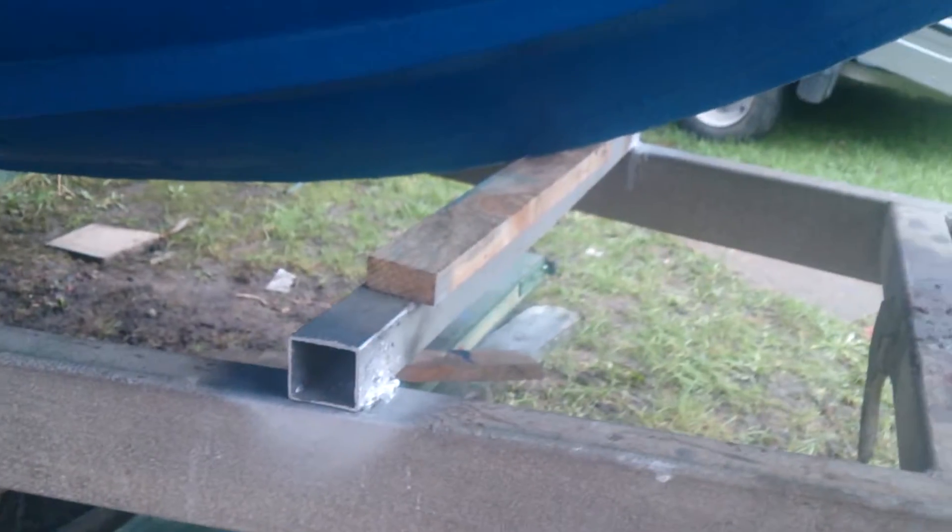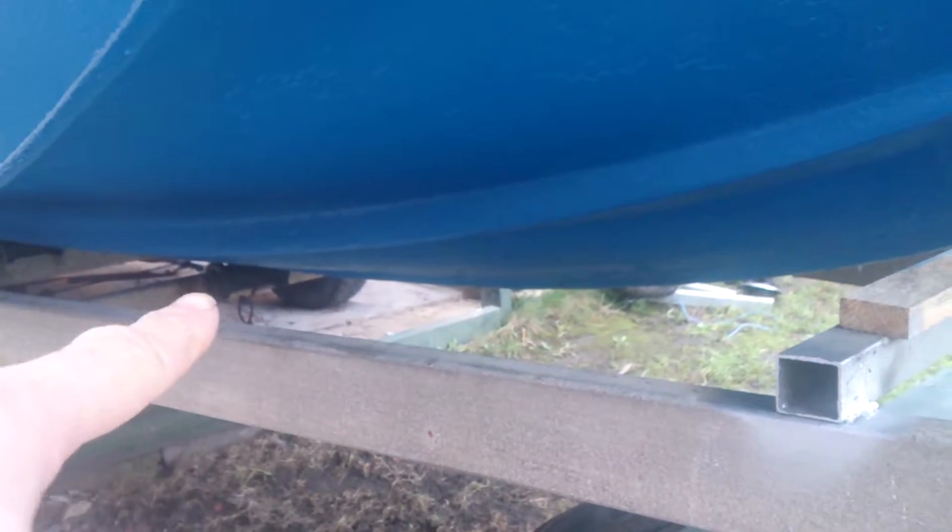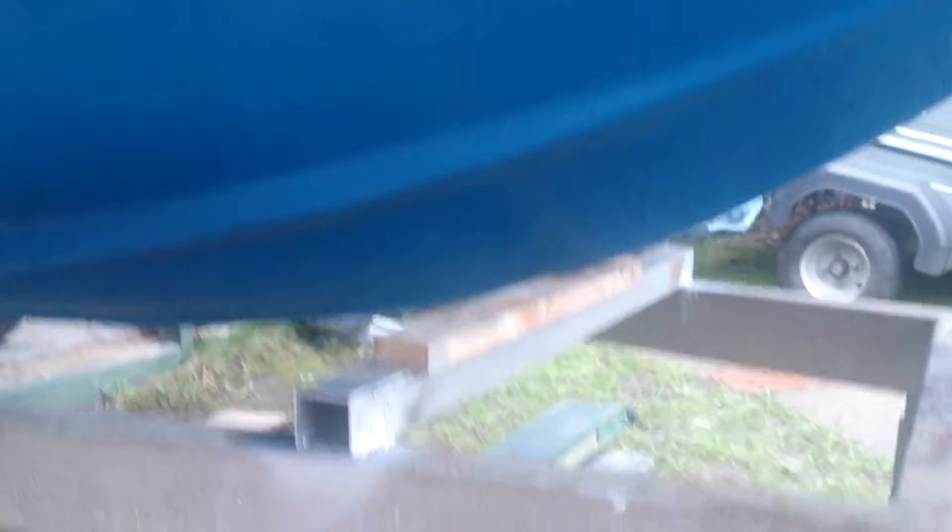Just got the trailer to finish. It was a double axle trailer, however it was not the trailer for this boat and it's far too big and too heavy. So I took one axle off and moved the other one forward. I've just got the bearings to redo - they're not too bad actually, I'm just going to re-grease them. I've put new rollers underneath - not all of them because there's that many. I think I've put three new ones on and there's a spare as well; I think there's about eight or nine in total. I'm in the process of putting this cross member on here to support the front, because the nearest support for the boat is there and it's probably four foot to here, so I've put an extra one in.